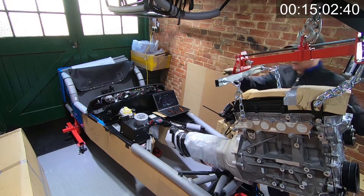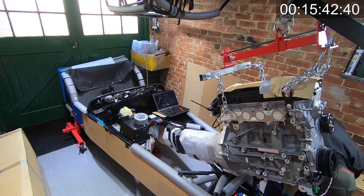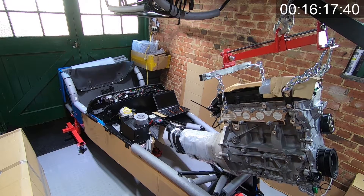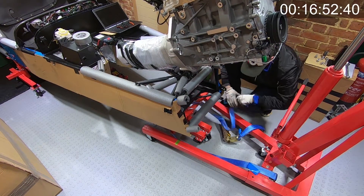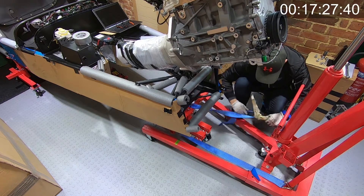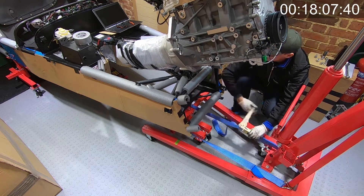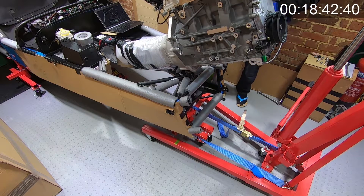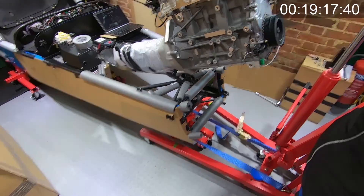One thing I learned very quickly when moving the engine hoist with the engine and gearbox attached is it isn't very easy, especially if you have a floor with a raised pattern like mine — it makes minor adjustments even harder. My solution was to use a ratchet strap around the front of the mobile axle stands and attach it to the engine hoist. With the sheer weight of the engine and gearbox on the hoist, this prevented the hoist from moving and actually pulled the chassis closer to it. This worked rather well, as the chassis seemed to go over the floor bumps a lot smoother than the hoist. One click of the ratchet was roughly only 5mm of movement, which was great for finer adjustments. I cable-tied the axle stands to the chassis to prevent them from moving out from underneath.